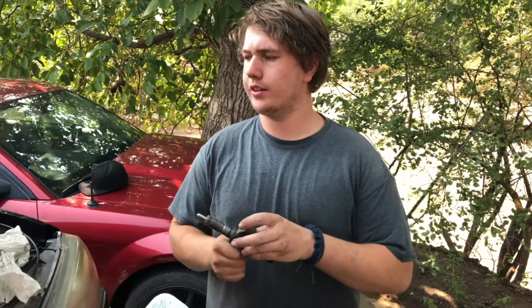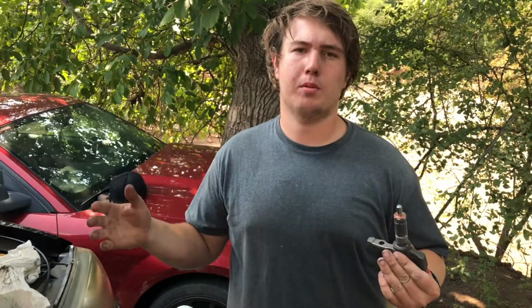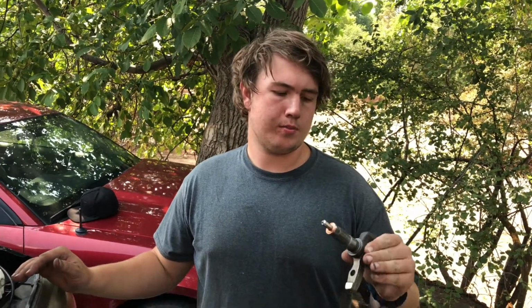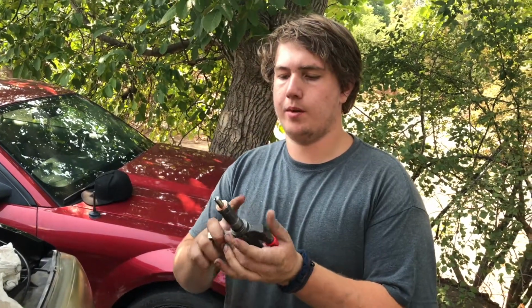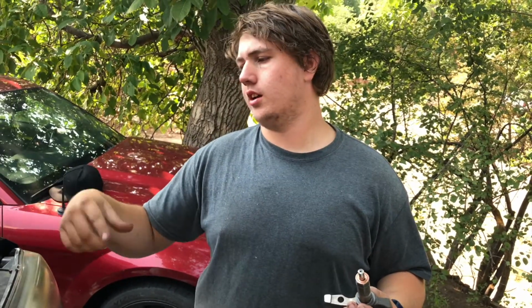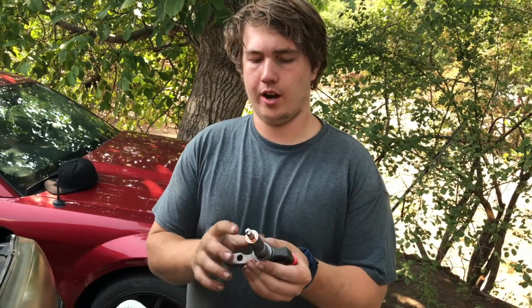We're putting our new injectors in. We decided to not pull the cups. They all look pretty decent, and none pulled out with the injectors. So now we're just putting the new injectors in. So we lubed up the O-ring, and now we're setting them in. Make sure you got your coppers on and your old coppers out, and get the injector cups cleaned out so they seat right.